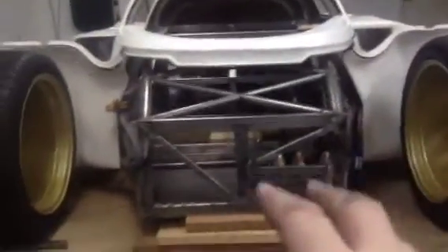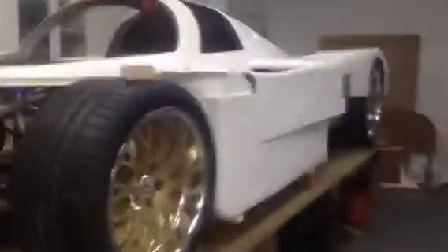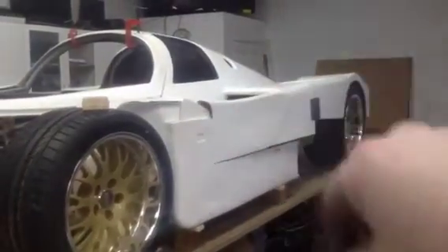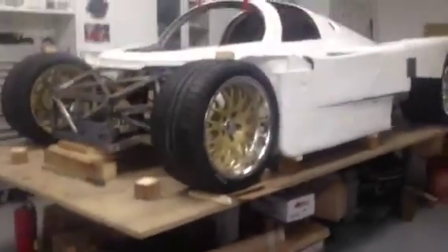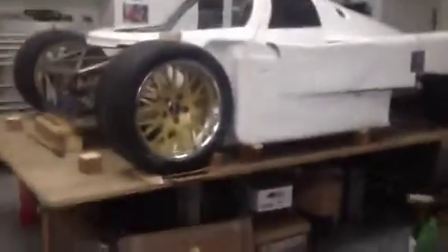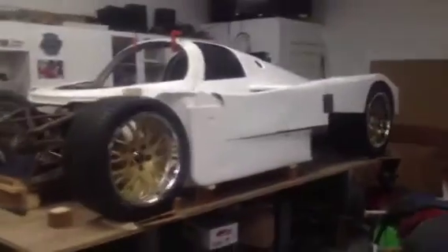Best to do that once the car's rolling — then I can put some fixed points out from the chassis and get it on. I'm a little bit happier now that I know where the major fault is. The error really is in this back panel, and it's impossible to get the door shut close when that panel is so far out. Anyway, got my two dimensions, got my revised chassis height. I'll have to lift that up so I can get on with the CAD, finalise the wishbones, finalise the rear uprights, and then we'll be doing a big billet order for the engine–gearbox adapter, rear uprights, and rear plates. Wheels on — it does suddenly make it look like a car.